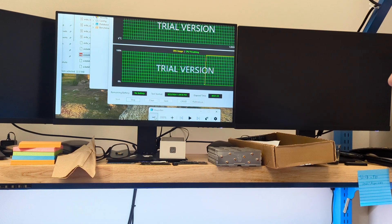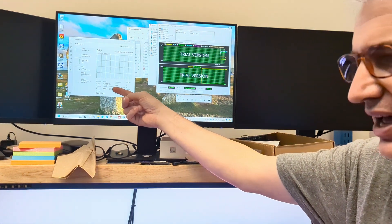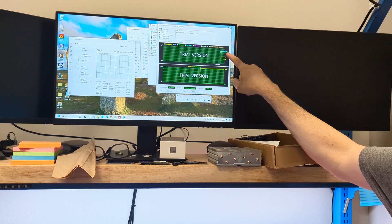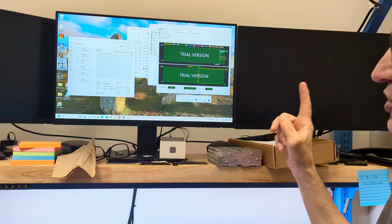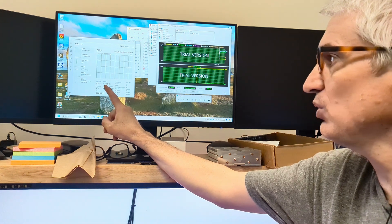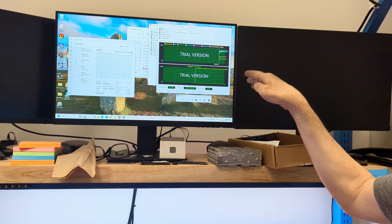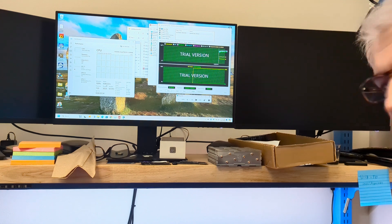We're holding steady right around 4.9, 4.89 gigahertz. We've dropped just 0.05 gigahertz — that's a fraction of a percent, so small no one would notice it. And yet we're being so much better to our processor at 86 degrees. At 253 watts this would go below this number if we let it run longer. We've reached equilibrium with our water temperature, leveled off at 86 degrees, with no throttling.